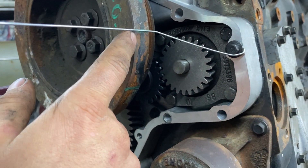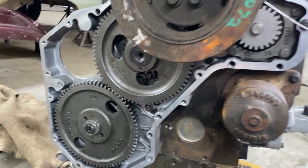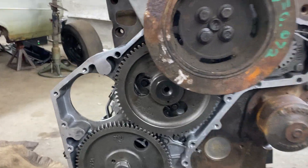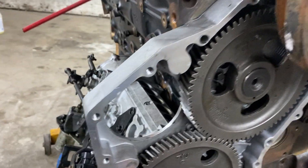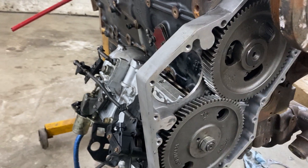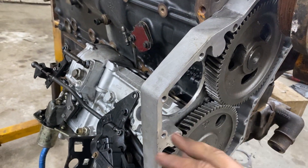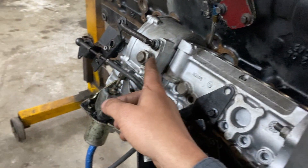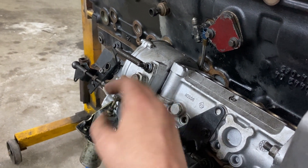In this application I need to advance it by 30 degrees, so I multiply 0.072 by 30 and that gives me 2.158 inches. I take my caliper and measure out 2.158 inches. When I bar the engine counterclockwise — which advances it — I want the indicator to line up, then tighten it up and the gear is on. For stock engines: a 94-95 with a 160 or 175 pump will be 12.5 degrees, and a 96-98 with a 180 or 215 pump is 14.5 degrees.